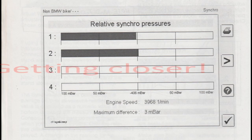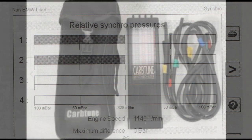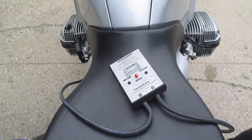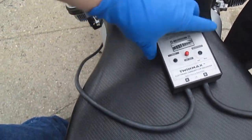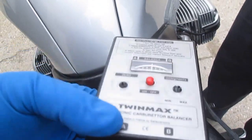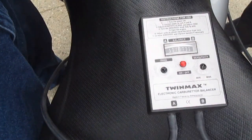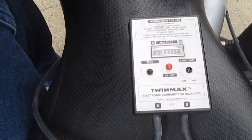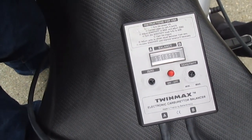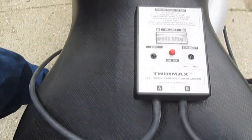After you get it all tuned with the Modi Tech — which doesn't do a whole lot — you can do the same thing with a carb tuner, a Carb Mate, a Twin Max, or a tube with automatic transmission fluid in it. You're just balancing the air intake left to right. You can see we're off, pulling to the left side a little bit. That's corrected with your air screws. Under load it's nice.